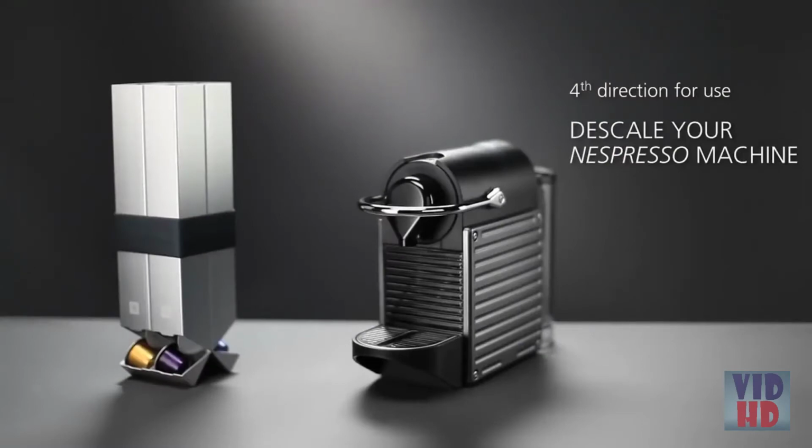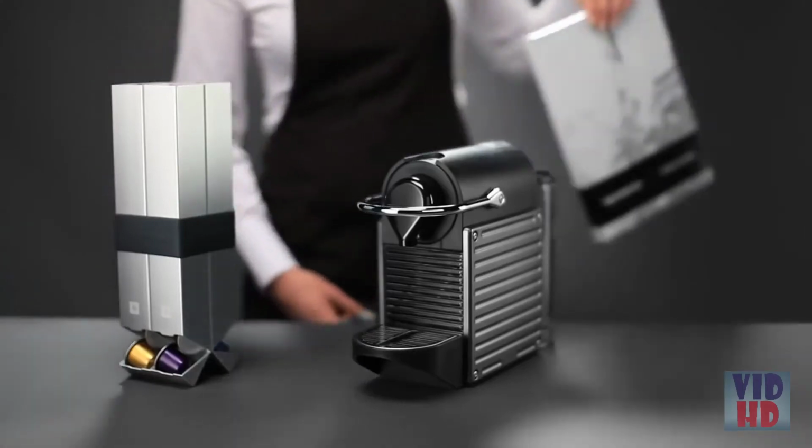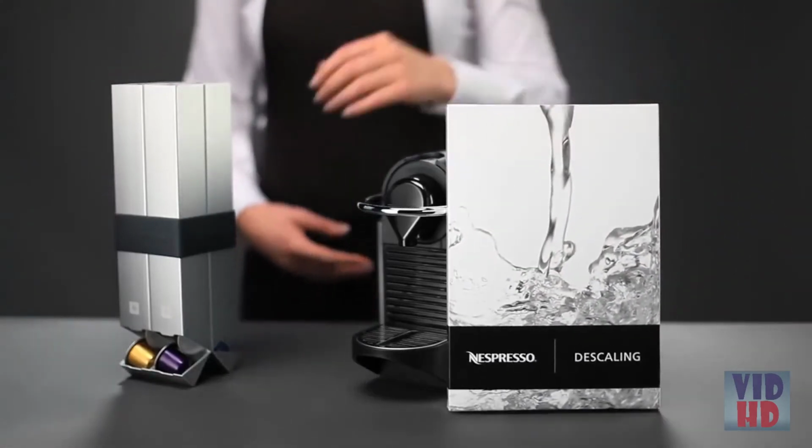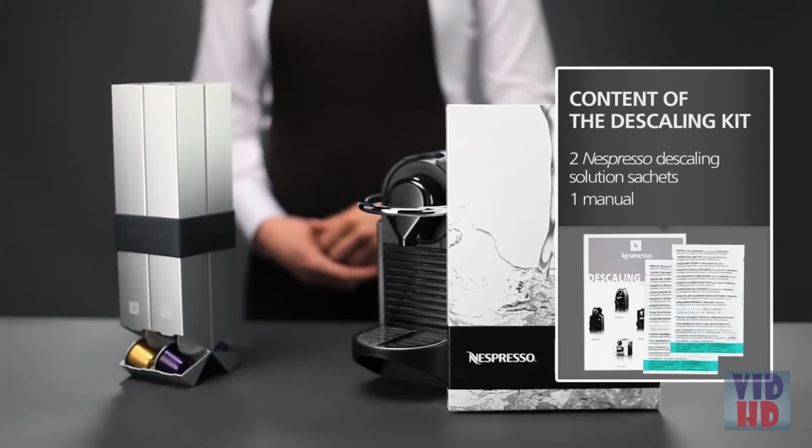To maintain the optimum temperature and quality of your espresso, descale your machine regularly. We suggest that you do not use vinegar as it may damage the connections of your machine. We recommend you use the Nespresso descaling solution specifically designed for your machine.